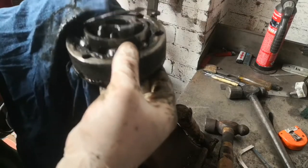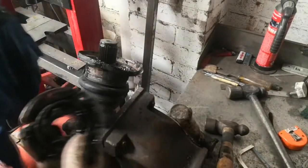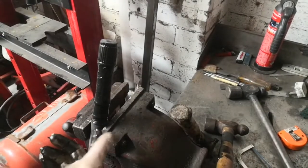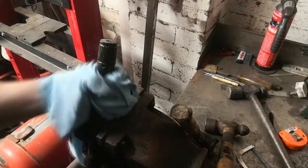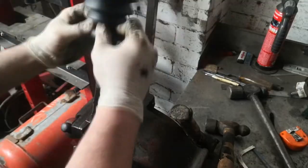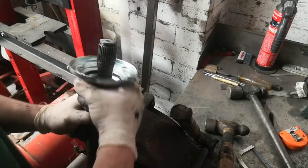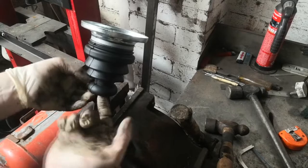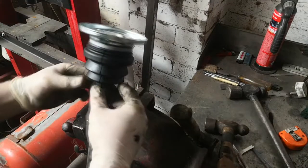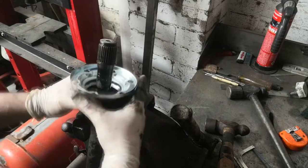You've got to be careful not to let it come out too far, because then you've got to put the CV joint back together and it can be a bit of a pain sometimes. That's the old one off — I'm going to clean that up and put the new one on. I'm going to use a slotted screwdriver just to push that lip back out. There we go, so that lip's back out now. Push it all the way to the bottom and then when we put the new CV joint on it won't be getting in the way.